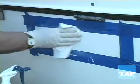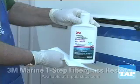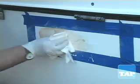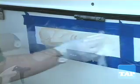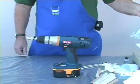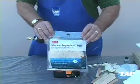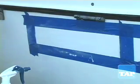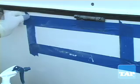Wipe the surface clean and use a rubbing compound such as 3M One-Step Fiberglass Restorer. Apply it to the cloth and rub thoroughly, turning the cloth frequently. If you have access to a power buffer or buffing wheel, they can make the job easier. Once the repair has been buffed out, it should be nearly invisible.